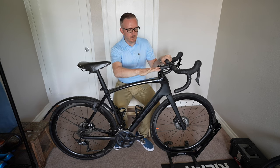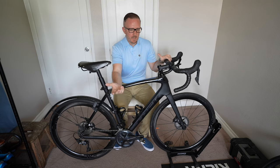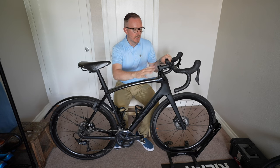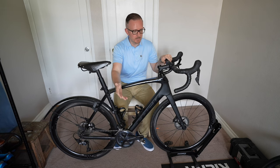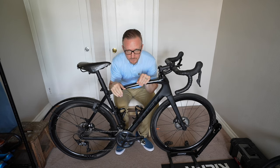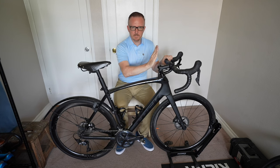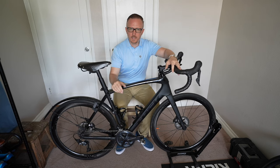A couple things to make sure of — if you slam the stem and cut your steerer because it looks cool, you're not going to be able to raise the stem. Every time I've ridden with a slammed stem after not riding for a long time, it only takes a couple of rides, maybe a week of riding a lot, and then you're good to go. It is kind of nice to be able to raise your stem, especially if you're riding in the city in and out of cars and traffic. You can sit more upright, not have to push your glasses up, and it's just going to be a little bit easier to see around you. So if you do want to cut your steerer, just make sure it's going to lock you into that position. I hope you enjoyed it — I'll see you in the next one, thanks for watching.